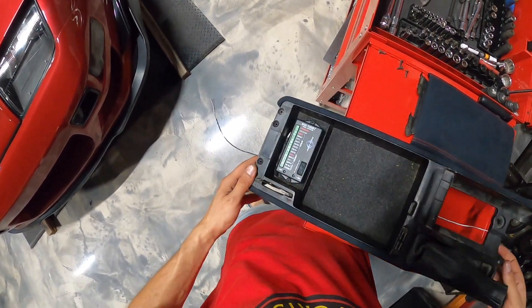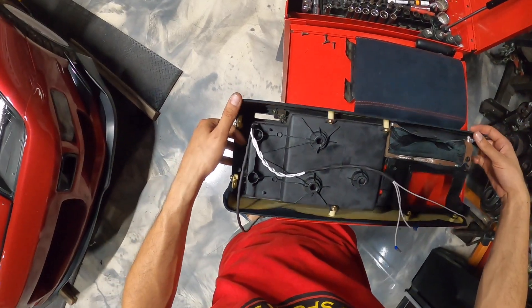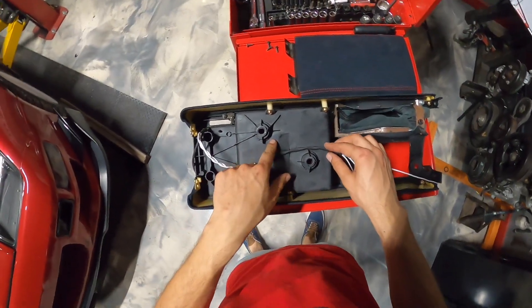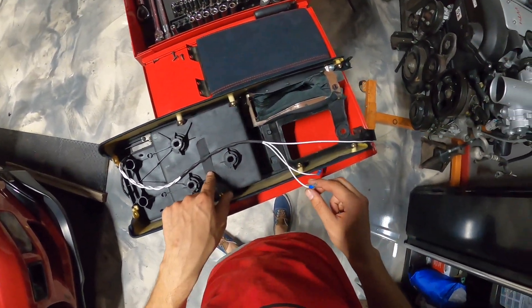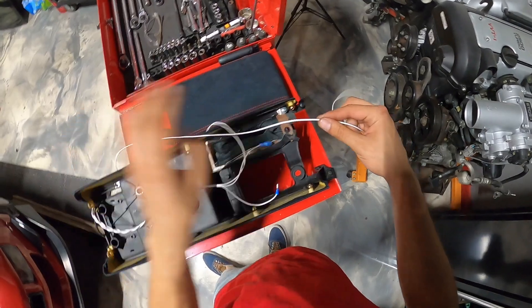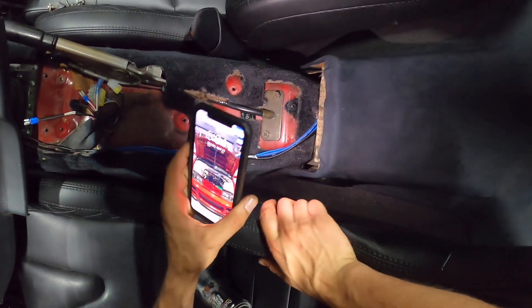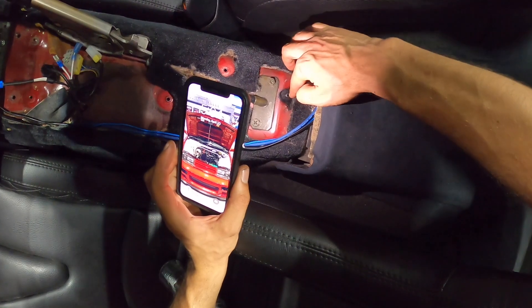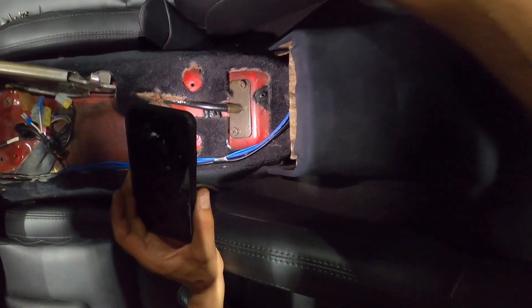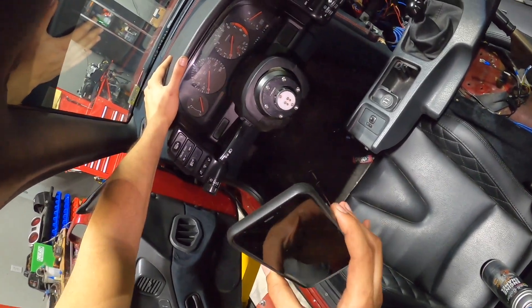So here's where I'm at - we've got it mounted, with the harness kind of in the back there. I'll shield it up, and if you flip it over, these two wires are going to our sensor. I braided everything together and taped it to the bottom panel to keep it in place. We have our power and ground right here, and this wire up here is going to our speedo on the dash. I took the T-tops off - might as well take advantage of the light. I went ahead and drilled a hole and put a little rubber grommet so we can feed our wires down through to our sensor. We also gave it a little paint so it won't rust. Now I'm going to rip out this gauge cluster to get to the speedo wire.